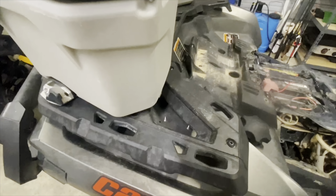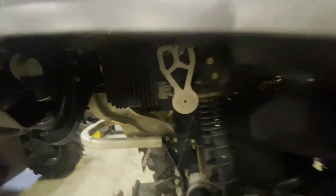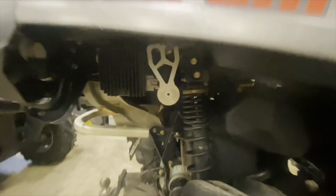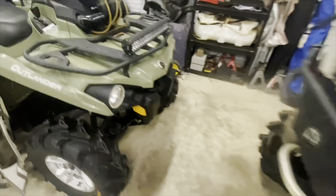Here's how I mounted the rock lights. You've just got to drill - if you don't like to drill holes you could probably use self-adhesive, but it doesn't come with adhesive. Two small holes the size of the bolts. I mounted them right under the back fender. You hold the nuts there, drill two little holes, use the little rubber backing so they don't rattle or make any noise. Then I took one leg of the wiring harness and stuck it up through there, trying to find the best route. In the back it goes through there and comes out the other side. Same thing on the other side - just eyeball it and mount it in the same position, then the wiring goes right up through there.